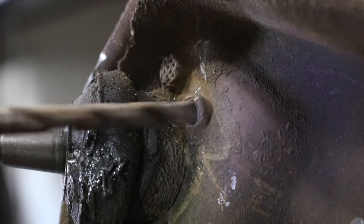As far as length goes, they are in between those two measurements. So the Chevy Blazer line is a little bit longer than the Chevy Vega line. However, the block on the end of the Chevy Blazer's line means that you can only orient it in a way that's basically straight down, taking up a lot of that slack, and it doesn't give you the ability to turn all the way without it binding the line.